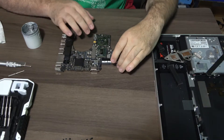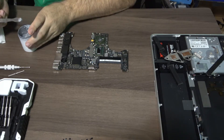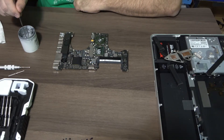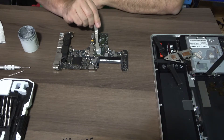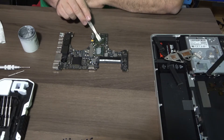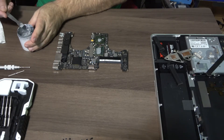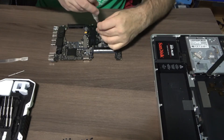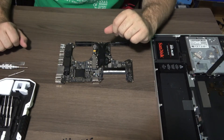I had to wait a while and let the board cool down, let the chip cool off — everything's nice and cool now. We're going to put some new compound on this guy. Nice little coating, not too thick, because once it's applied properly it's going to squish off to the sides anyway if the aluminum is making the proper contact it's supposed to make.